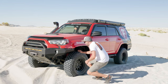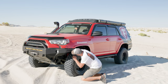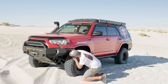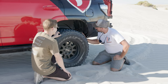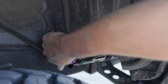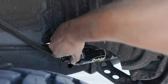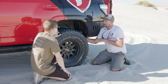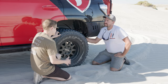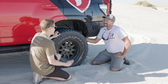So what we're going to start with is the low-speed and the high-speed compression adjustment knobs — and it's not vehicle speed, it's shaft speed, so how quickly the shock is traveling back into itself. The black one is the low-speed compression, and that really fine-tunes out the little, small, chattery-type things. The purple one, the high-speed compression, is the one that hits the big whoops and really fine-tunes that. So we need to stiffen that up so we don't bottom out as much? Exactly. Let's run it again.